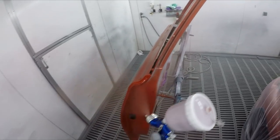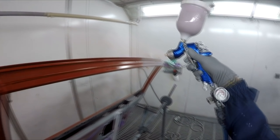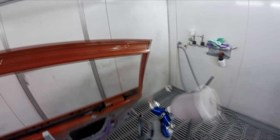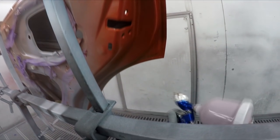I don't want to go and get this door on the car and then find out it's slightly see-through. Reds and oranges are renowned for not covering too well in solvents. If this was waterborne it would just be one and a half coats as usual — well, with the Chromax Pro that I used when I was spraying water anyway. Through all its flaws, I still like solvents.